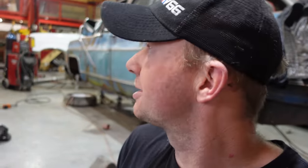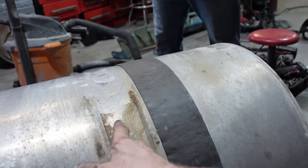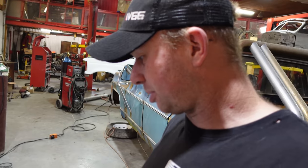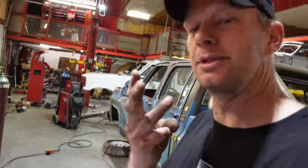We're gonna mess them both up. If it doesn't work, we got zero tanks. But we're gonna cut this and then cut the other tank, behind the strap, and then weld this piece to the other one. And that eliminates two problems at once. Gets rid of the pitting, shortens the tank, and no dents. Three problems. Look at that. Solving problems all day. Here we go.